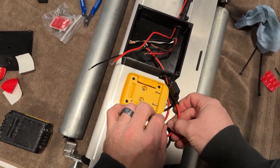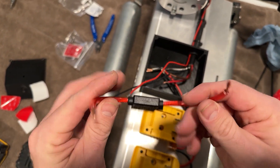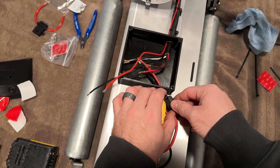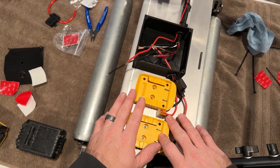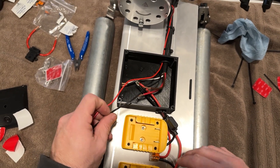My adapters have a fuse block wired in, which is pretty handy. The pro wiring kit comes with the fuse block. You don't have to use a fuse — I haven't popped one yet in all my testing — but it is a wise idea because it protects your batteries and other components like your controller from getting blown. I would recommend installing a fuse block.